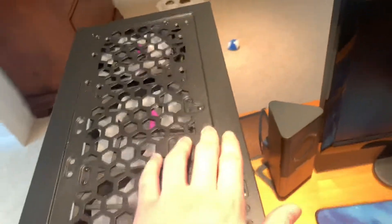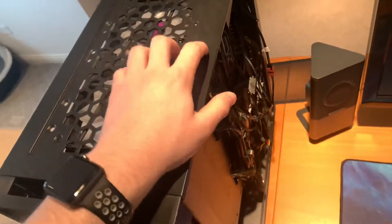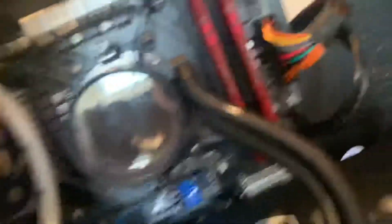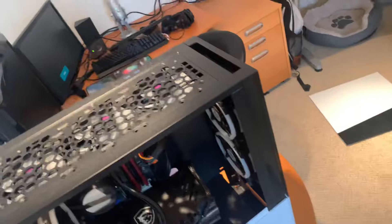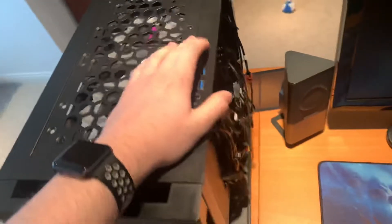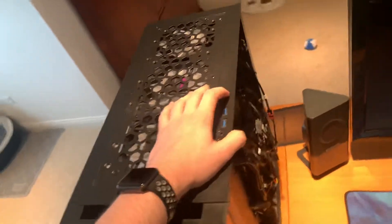Another thing I was able to do is take the RGB connection — here is the RGB hub. One of the cables was loose, it had an end that you could connect another cable, like a daisy chain. I was able to daisy chain the RGB of these three fans into the port, which allows me to control all of the lights with this button. Further, you can take the output that's currently going to this light and actually plug that into the motherboard, which allows you to control the lights with the motherboard and with software, which is pretty cool, but I just kept it with the button. The button's good enough — it has enough options, and you don't have to mess around with the BIOS. You just click the button and it changes.